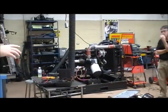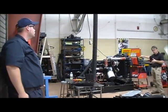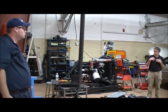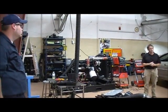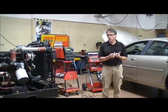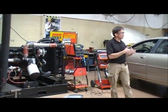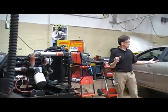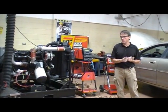So that machine can check multiple batteries at once? It can. When you go into battery test it asks whether you want to do it in-vehicle or out of vehicle. If you say in-vehicle it will ask about multiple batteries. In reality if you're working on a set of batteries you want to test them individually, because if you have one weak link it might still pass overall. For you diesel guys with vehicles that have multiple batteries, you want to make sure everybody's pulling their weight — if one battery isn't, it causes stress on the others. So if you're working for a fleet or government entity and one battery goes bad, it's a good idea to take that whole set out and put a new set in rather than just replacing one battery. Some fleets may not go for that because it's expensive, but that's the best case scenario.